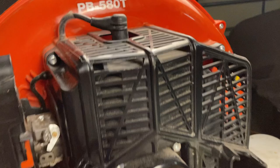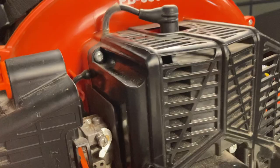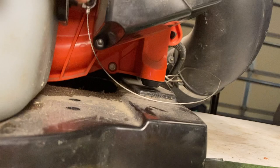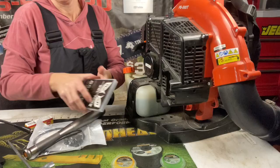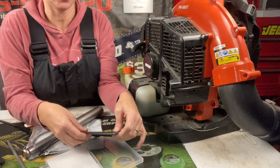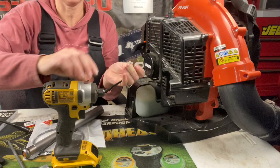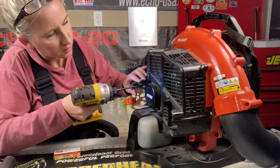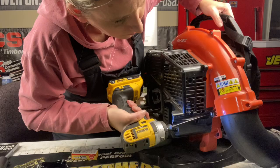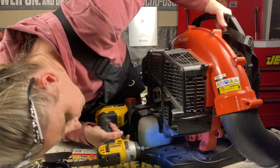You're probably watching this video because you didn't register your unit and you're doing it yourself — the cool thing is, it's super simple. We just need to remove the screws holding the shroud on: one up here, one on the other side, one down there, and then there's a super secret screw right there. We're also going to remove the four bolts holding the rewind on. I'm pulling out my Owl Tools six-inch Torx bit set — I'll leave a link in the description. It's got T7 through T40, and I'm using my T27 here.